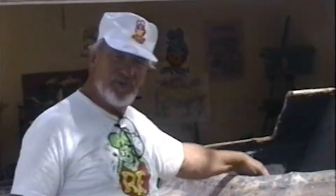It's cheap too — this whole body so far has cost me 150 bucks, and all I've got to do is prime it and paint it. I'm not into spending a bundle like these other guys with the aluminum bodies, because the disadvantage of metal is that you've got to know what you want before you start. Once you form a piece of metal, it's hard to make it a different shape. The advantage I have is I just get my Bondo file out and file the plaster down to the look I want. Then I put fiberglass over the plaster, and just when the fiberglass hardens, I knock it out with a little hammer and the plaster's gone.